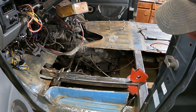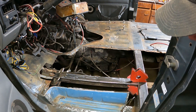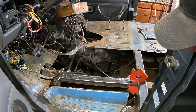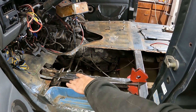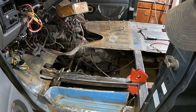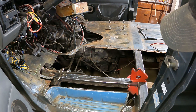Then I've got to make a brace across here that ties into that centerpiece floor — comes straight across and ties in over here, putting all the bracing back where it needs to be. After I get this welded in, I'm going to go over and remove the last section of floor panel that needs to come out, start cleaning the edges up, and get the thing ready to fit the floor pan in. It's coming out good. I've got to do a little bit of grinding through some spot weld sheet metal areas to get that all smooth and ready to tie in. It should be plenty strong — as strong as it was originally.